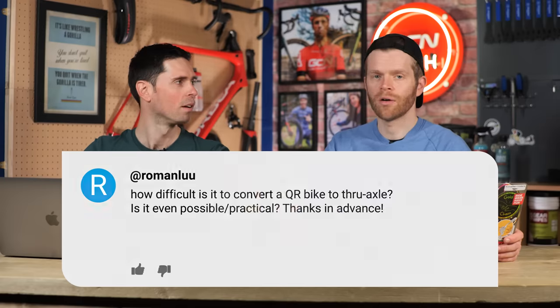No — quick answer: no, don't do it. There are axle adapters that will make thru-axle wheels fit in a quick release frame, and they cost under £20 or dollars. A lot of brands, like when Mavic used to sell their wheels with the adaptability to turn them into either, that is the way to do it. But don't modify your frame.